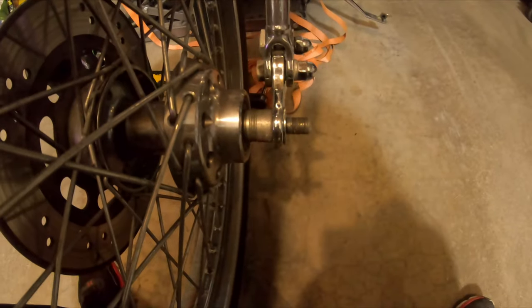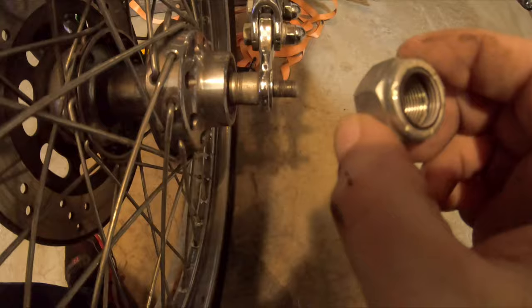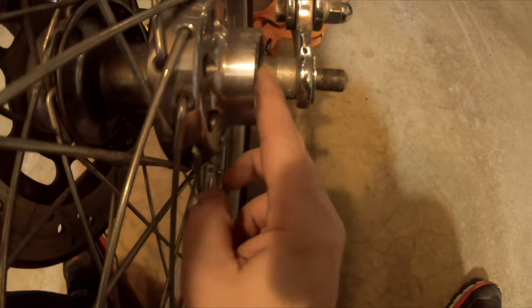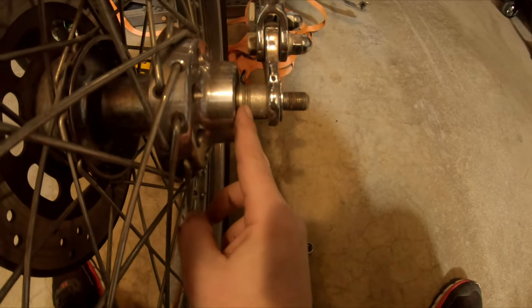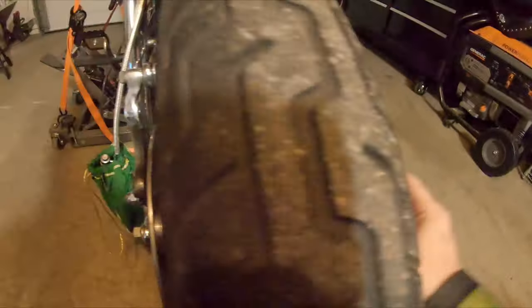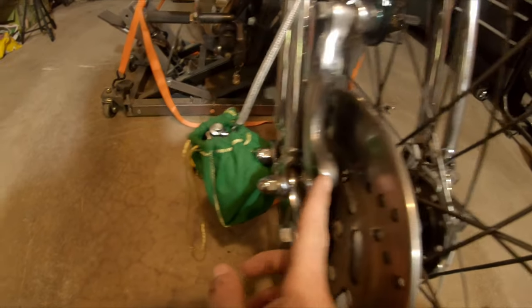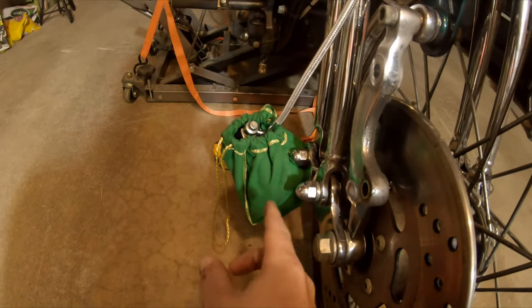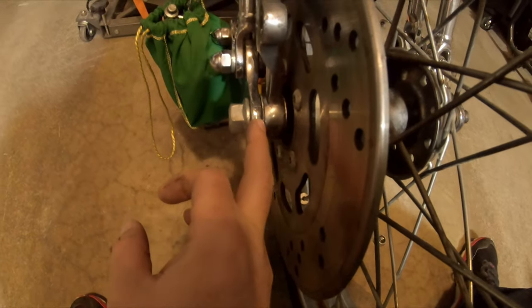So that was a bit of a bear because apparently I don't have a 15/16ths in a half-inch drive, so I had to get out the old breaker bar to get that bad boy out of there. We do have a spacer here and there are little lines in there. I don't know if the orientation of this matters, but I know that the wheel lines up now, so that's the way it's going to go back in. It's not looking like I'm seeing any other spacers — the caliper bracket is bagged and set aside. I might have to get brake pads for it too after looking at those things.